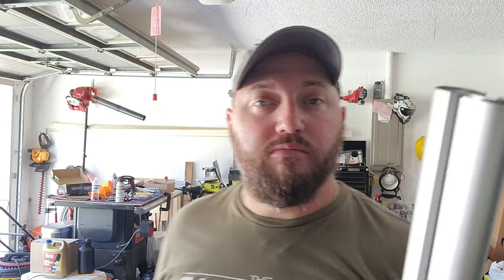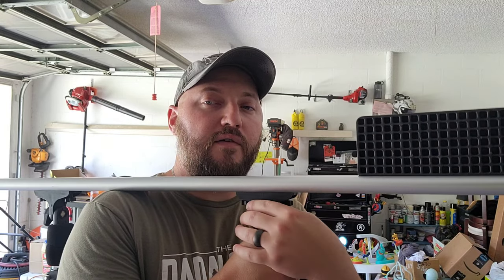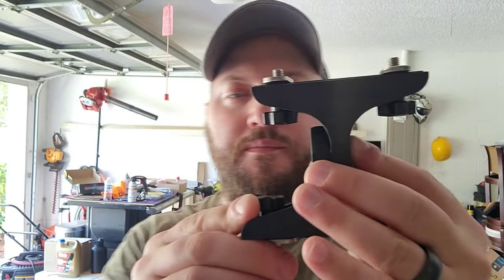It went pretty good. Considering all the modifications I did, I need to eliminate these legs. I had already taken off about four inches and hoped that would be enough to make it more stable — this is obviously the troll motor mount. But overall there was still too much flexibility with the troll motor mounted, even in the water. So I'm going to try to eliminate this leg altogether and mount it directly on the kayak.